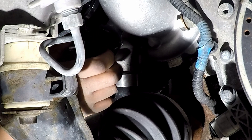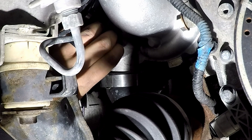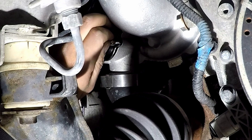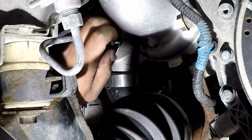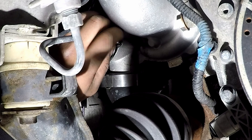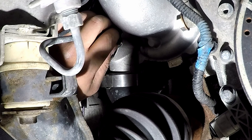The flush part will be facing up and to the right. Now here comes the tough part — getting at least one of these bolts started to hold everything else in place. The new bolts that came with the TurboSmart are exactly the same as what the Mountune uses, so it's your choice whether you want to reuse the hardware or go with the brand new stuff. They are both H5.